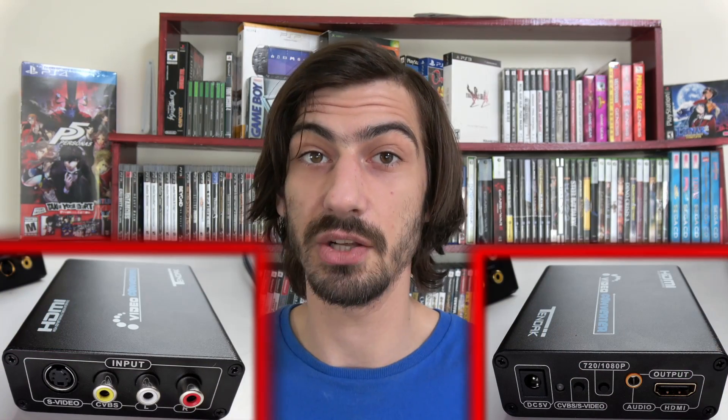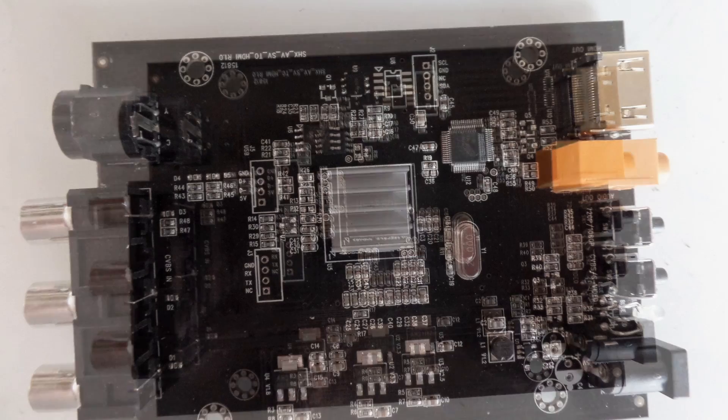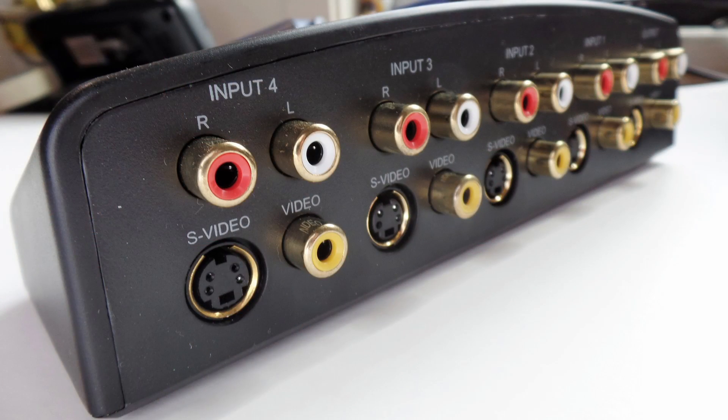Today, since all of these consoles support S-Video, you can use an S-Video to HDMI adapter, which converts the analog signal to a digital signal. These converter boxes can burn out, so I have them plugged into a separate power strip and turn them off when not in use because they tend to overheat. I actually added a heat sink to mine to help preserve it. That's how I record now — all my new gameplay footage will be in S-Video. I also use an S-Video switcher box so I can plug all consoles in at once and switch between them.